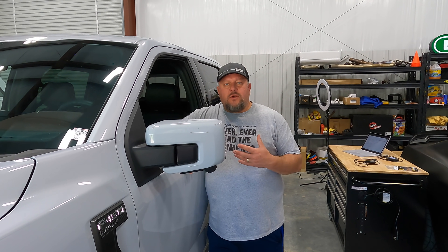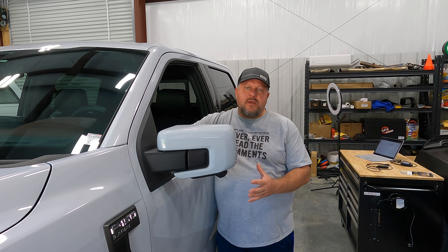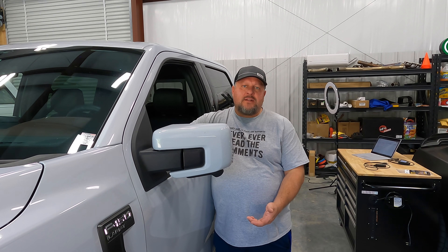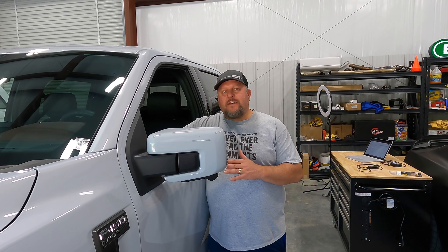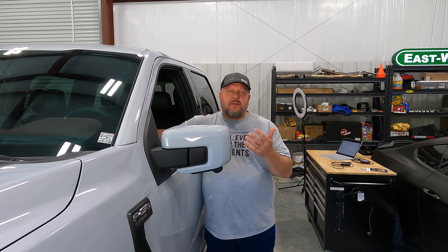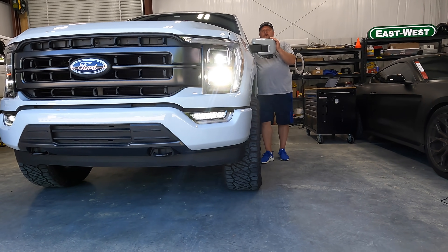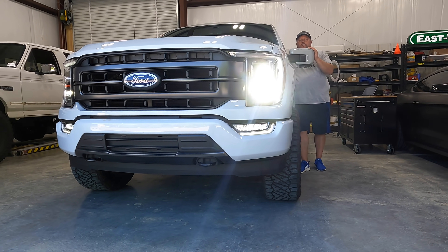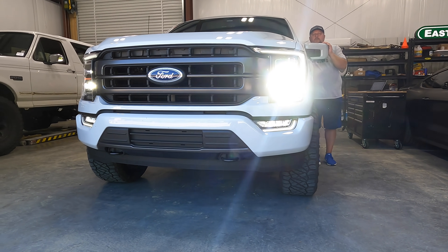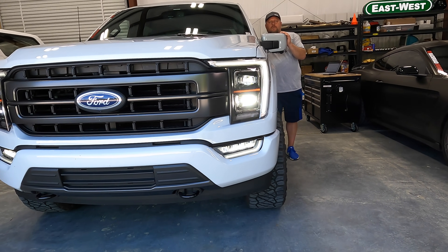Another feature that is also available right now is Bambi mode. What Bambi mode means is you can have your low beams, your high beams, and your fog lights all on at the same time. From the factory, your low beams and fog lights work simultaneously, but when you flip on your highs it cuts off your low beams. When you make this mod, all the lights are on at the same time so you can see bambi. The lights may look like they're flickering but that's because they're LED. This is regular beam with the fog on - now hit the brights - he's got the highs on and the fog lights are still on. Without Bambi mode, your fog light would disengage as soon as you go to high beams.